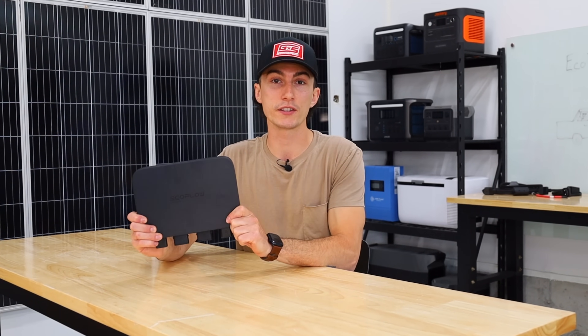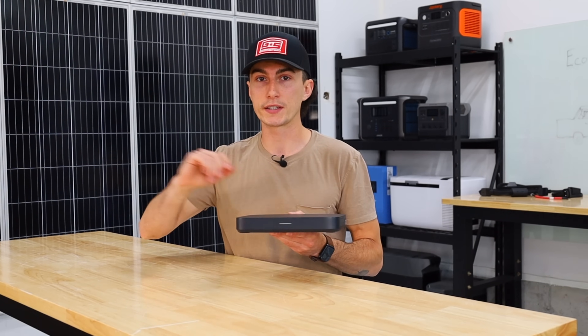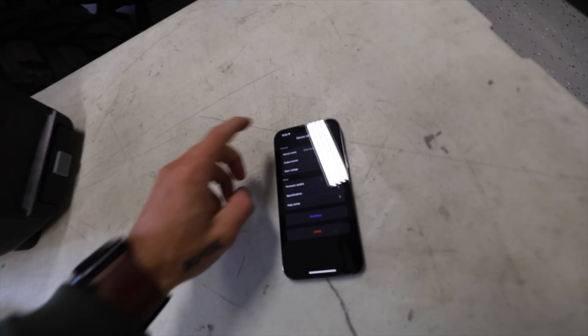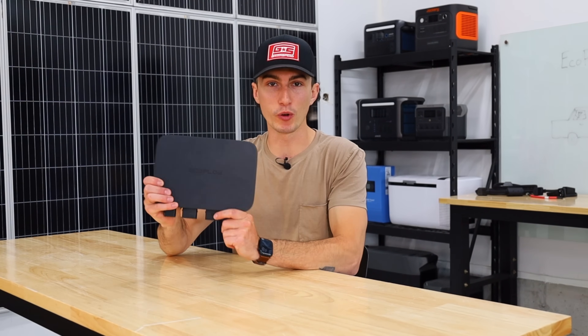If I could give you my two cents on the install, it would be to wire it with an inline switch. I have a full bus bar in my Jeep with switches wired into the car. This unit will always be on — there will be a little light right here that's always on, it's always sending out the WiFi signal, it's always reading what the battery's at. It will eventually kill your battery even if you're not using it. There is a manual power button on the side, and you could shut it down from the app under settings, but you have to do that every single time you turn your vehicle off. I'd recommend putting an inline switch somewhere so you have to turn it on manually when you want to use it. We will be installing this in a future video, so make sure you're subscribed.